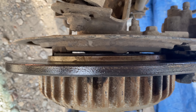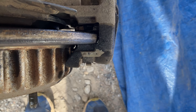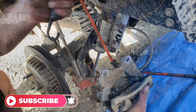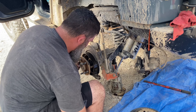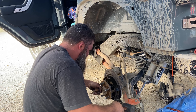Looking straight down — it's kind of hard to see — but you can see that the front of the rotor here is definitely kicked out further than the rear. If you look at the pad back here on the rotor, you can see it is definitely making contact with the outside. You can see a gap on the back there, but it is definitely catching — that's why we could hear the brakes squeal. It feels really light when I'm spinning it, so I think it's broken pretty close to the end here. That's why my e-brake doesn't work.